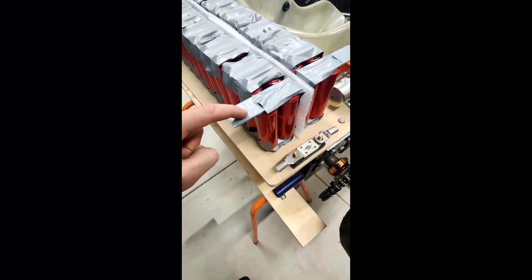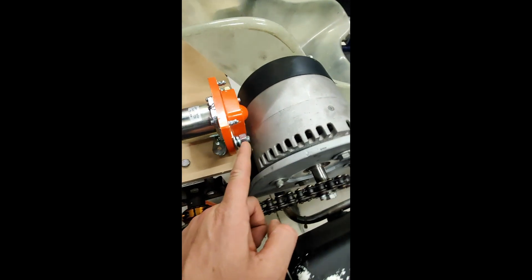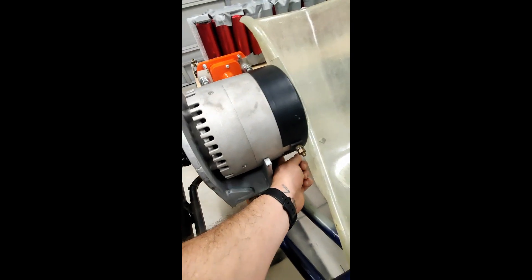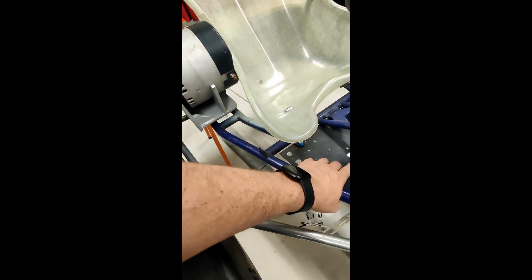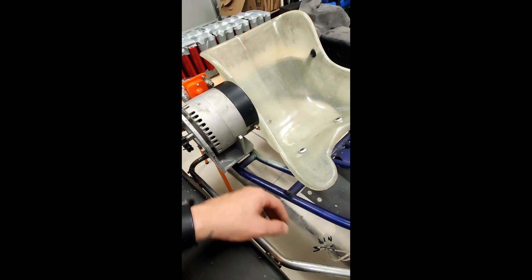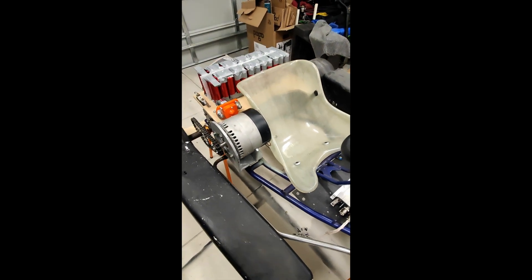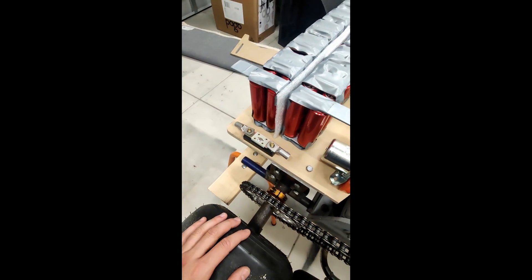I need a cable from the battery into one side of the fuse, out of the fuse into the contactor, then from the contactor down to the positive lug of the motor and also to B+ on the controller. On the negative side, the cable goes to the controller terminal but via the BMS which is going on the back seat. I've already figured out I don't have enough lugs but I can get more.